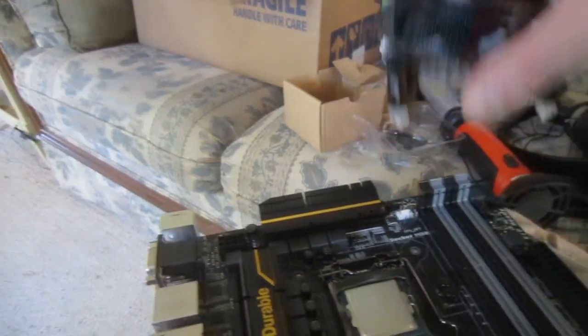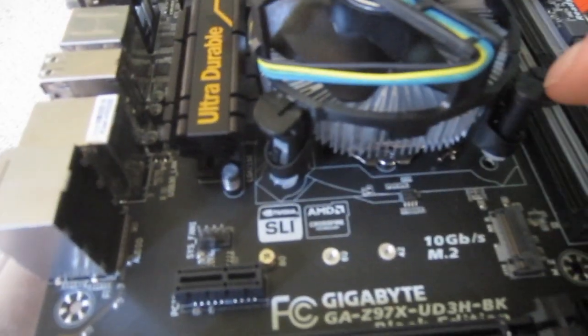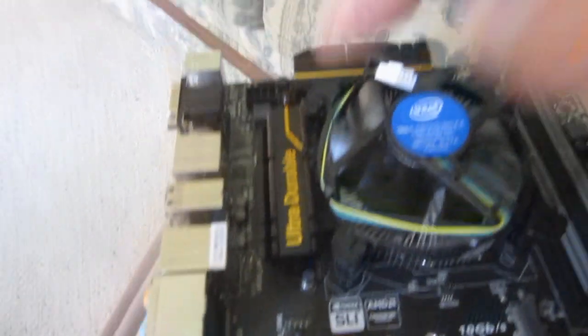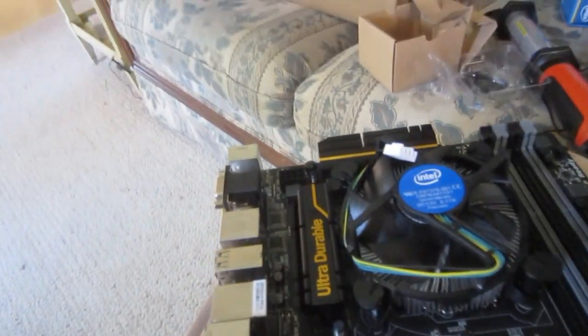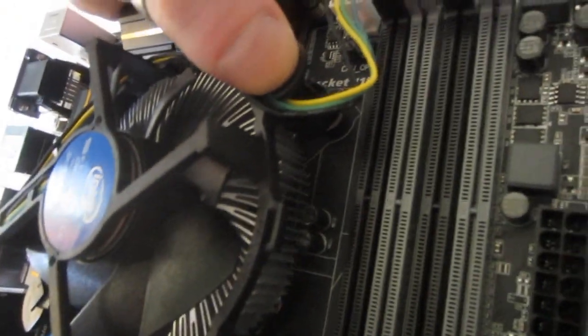The next thing is to install your heatsink. It depends on the heatsink you're using, but for this one it's just the factory Intel cooler, which should do fine. Position it over the socket and push it down — go one, two, three, four in a diagonal pattern. Force it down; it'll click and then it's installed. I routed the cable back around to the CPU fan header on the board, which should be the white connector. Put the board in, and you want to hear that good metal-to-metal snap. You might have to turn the pins just a tiny bit to get that actual click. And boom — she's done.